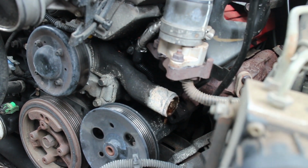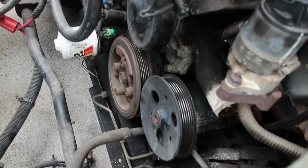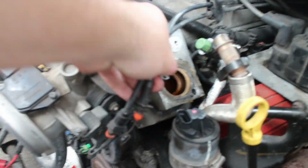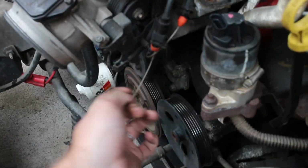So a lot of the wiring harness is going to be kind of hard to get to until we, I think, honestly, lift up the engine. Or lift up the body. I think you're right. Because I was thinking the same thing. We don't necessarily even need to disconnect this yet. There's a lot of stuff. We're going to disconnect the throttle linkage here. It just pulls off there.